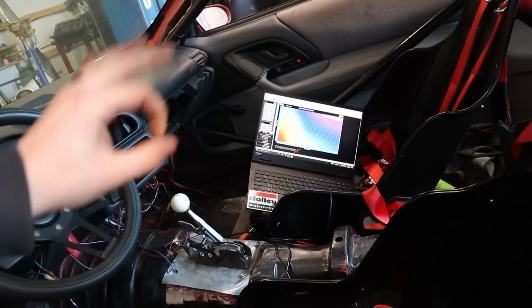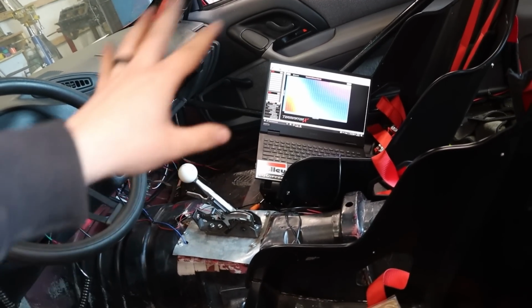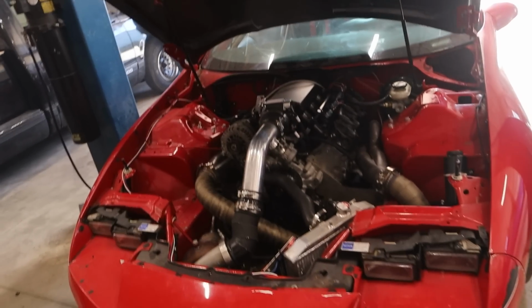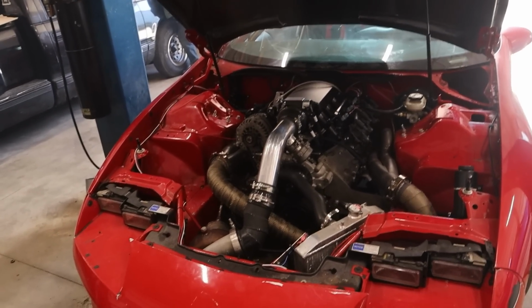The idle air fuel is perfect. Still got to clean things up a little bit though. And for some reason, it starts really hard. All right, well, never a dull moment around here. Got this thing idling perfect. Air fuel ratio was amazing. Nice and steady with the extended pipe because the O2 sensor was kind of close to the old pipe. So that was all great. Got the RPM perfectly in sync with what the tune is reading.